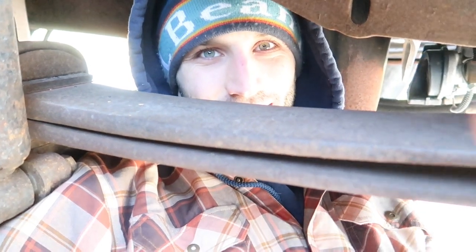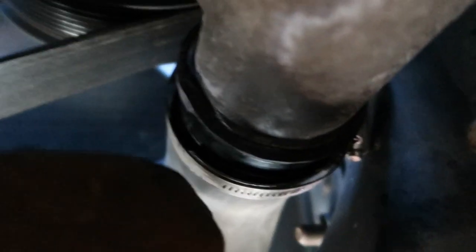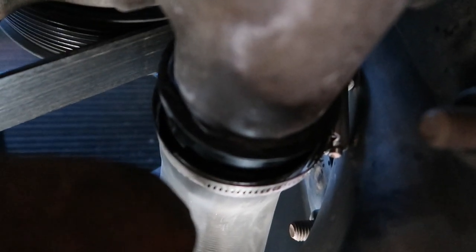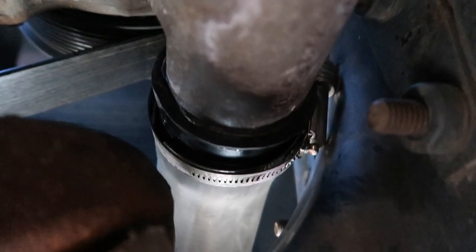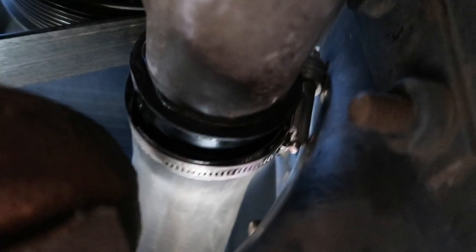Back under the bus. I've decided that tightening the hose clamp probably wasn't enough. I think where this was tightened it was actually splitting the hose. I guess maybe you can over-tighten it and that's what the person before me did. But there's plenty of room so I'm gonna try to just move it back farther along here so it's behind where it was splitting before, and hopefully that will be a better fix.